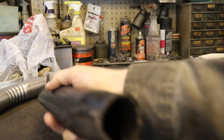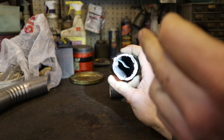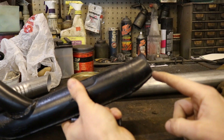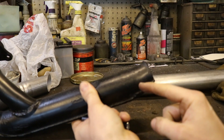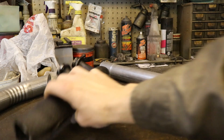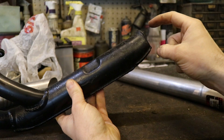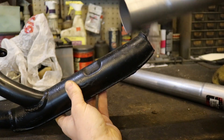Here's my stock exhaust — what's left of it. Inside there's a little baffle divider in there. I want to cut this pipe back to the taper — right about here — the baffle is right here. I also have a resonator pipe: it's a two-inch pipe with a flare on either end, and I got it for scrap basically. My plan is to cut it and weld a piece of that resonator pipe onto the end of the stock exhaust, just enough to give me a way to mate the turnout onto the end of this thing.